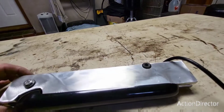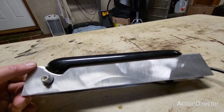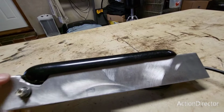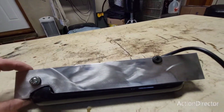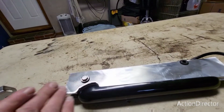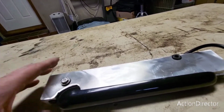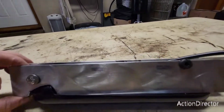But there you go. There's my $15, $80 savings if you think about it. And it didn't really take me that long to trim it out and cut it. Like I said, I used a cutoff wheel. Then I used a flap disc to massage it, finished it off with a half round file, cleaned out the inside and everything. So, yeah.